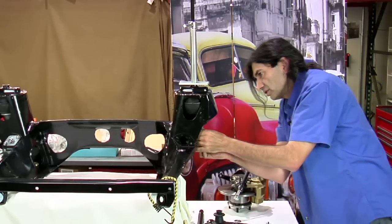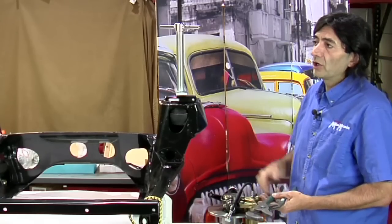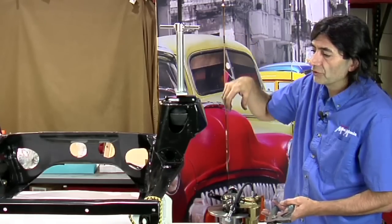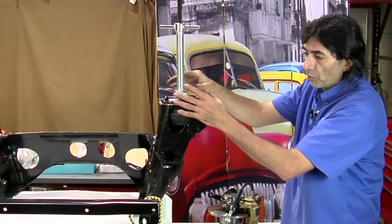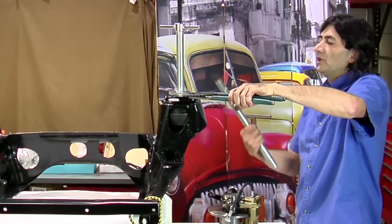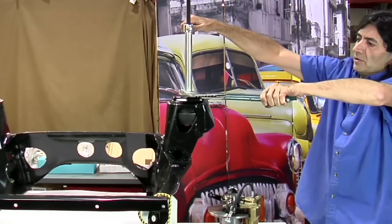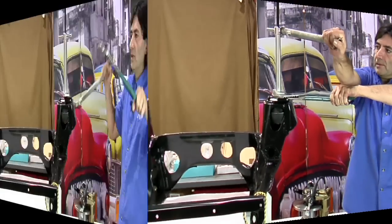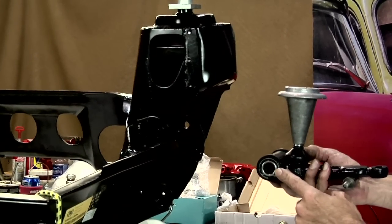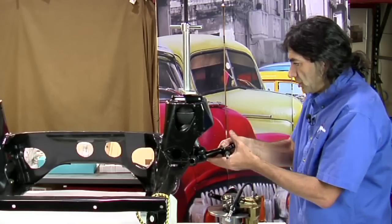We've already had some effect on it. There's our trumpet — it's pretty close. We just need a few more turns to compress that spring. If you're doing this in the car, you don't really have to worry about all this because obviously the weight of the car is going to help you. When the whole subframe is sitting on milk crates like this, we have to be a bit more careful. Essentially a large channel lock to grab the tool and a piece of pipe — you can see we are tightening up the spring compressor and therefore shortening the spring.